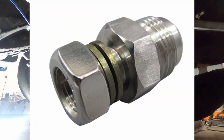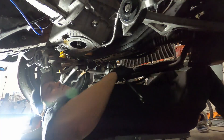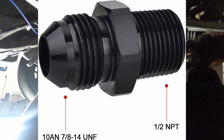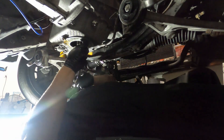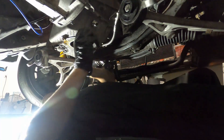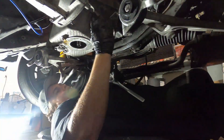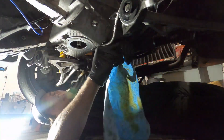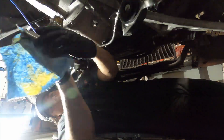The CX Racing kit comes with a style plug that requires a nut on the inside of the pan — this type is a pain, so I wouldn't recommend it. What I'd use instead is an NPT thread plug, so you don't have to worry about getting a wrench on the inside, and it'll seal great. The hose is a 10AN, so that's what you should use when picking a size for both the hose and the NPT plug. I've included links in the description. I also want to point out that I removed the pickup tube filter plate to get access into the oil pan from below — that's pretty much the best way to get this done without pulling the pan. If yours is leaking oil, make sure to replace that little gasket, as it's a cheap fix.